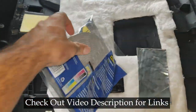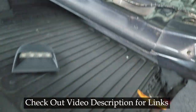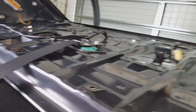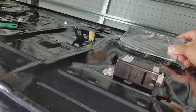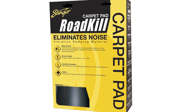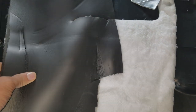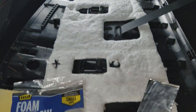If you want to get some foam to wrap cables or help in a pinch, this costs $2.50 at Lowe's — it's tape and it's foam, exactly what you need. I also got some sound damping material to use on bigger areas like right here where there's very thin metal. I'll put some of that on there throughout the back wherever there are large open spaces — this will absorb vibrations from the sub and from the road and just make it sound better. Finally, I have some leftover Roadkill from when I put some under the carpet. It's got a thin layer of vinyl and a layer of foam — this is the soundproofing material that will absorb frequencies like road noise. I'm going to cover the entire back with it.